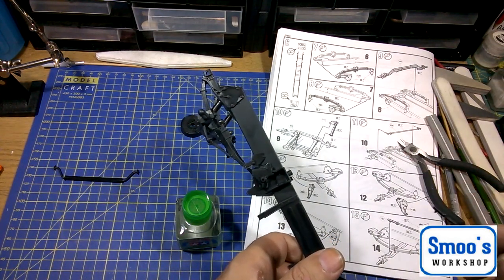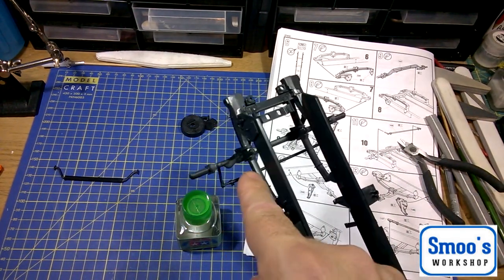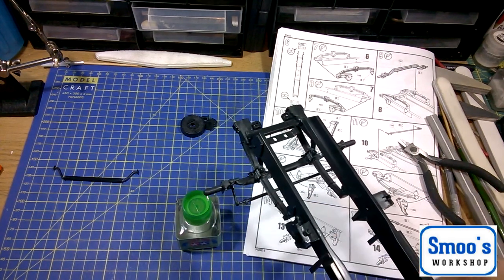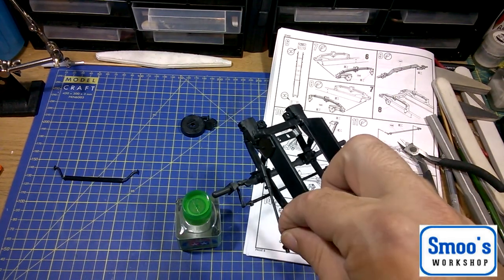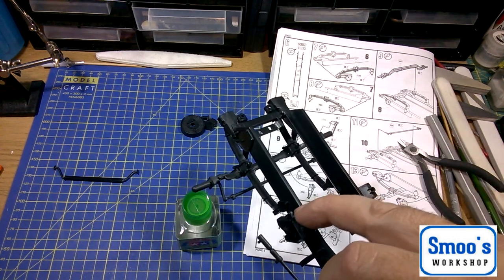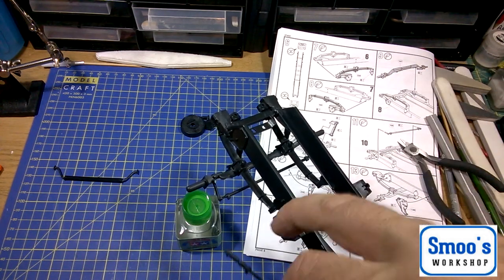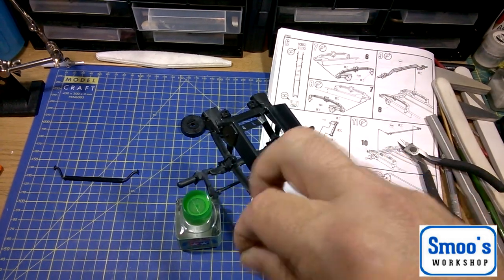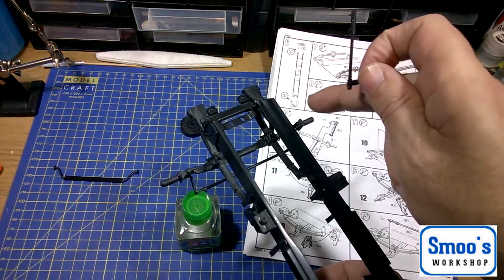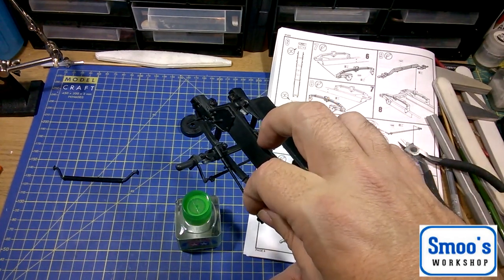It goes onto the steering box and it goes onto the steering arm. Hopefully this is coming up on camera. The steering arm there. So basically this is going into there. So this is the part that gives the instruction from the steering wheel, which is not mounted in the right bit in my opinion. But the steering wheel's turned, it goes down through the steering box, pulls this arm back and forwards, pulls that hub back and forwards, and because that hub's going back and forward with that link rod, it moves that one. Quite a simple steering system, really, really antiquated.